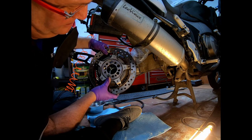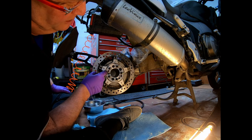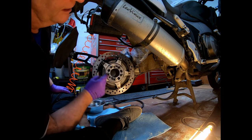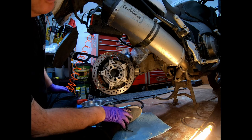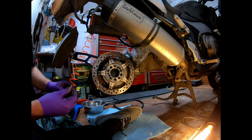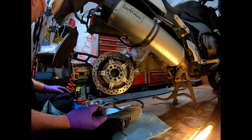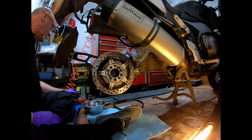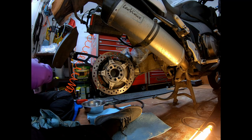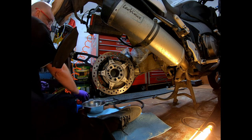As you've got your stud hole, you've got to make sure your dowel is next to your countersink, so it actually sits home smoothly. Again, this comes with the disc securing. This is an Allen key type. I'm assuming this is stainless steel, I haven't actually checked it with a magnet. For this one, I'm not going to use Loctite. Again, it's my own personal preference, because this doesn't do a great deal, so I'll just put some of my lovely nickel silver grease on.